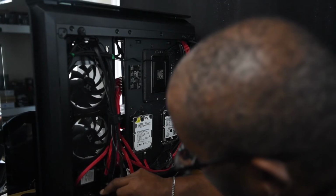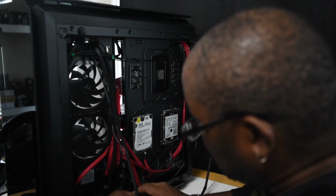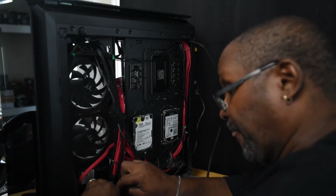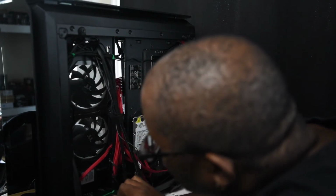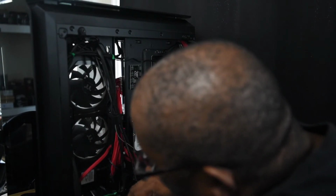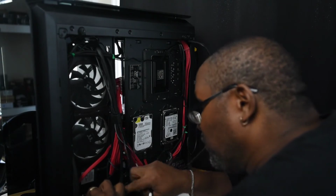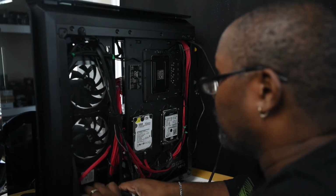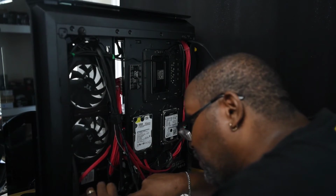And I unplugged that drive. Let's see. I got a little bit of a nightmare here, so I'm going to unplug this drive, because I have to pull out the 2 controllers for the fans. And I hope nothing gets unplugged. And I got to make sure, when you daisy chain these, it's 2 fan connections on this side. That's not the side you want to put 1 or 2 fans in. You need to put it on the side that has 3, and you need to put it in the correct order, or at least know how it is supposed to go anyway.